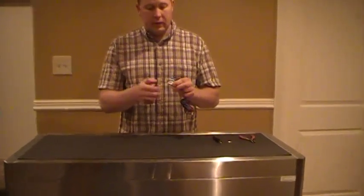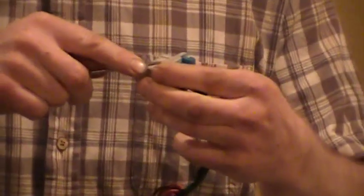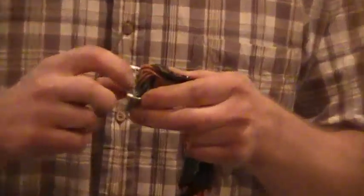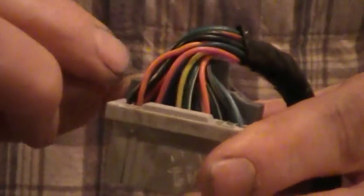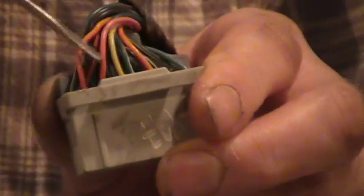I'm going to demonstrate how to get it apart. On this one, I need to remove the terminals from the top end. Take your little screwdriver and pop this little locking piece out. Mine's blue. On the 99 Silverado, Sierra, Yukon, Tahoe, and Escalade, you may run into the same colors. If you look on the back of this connector it says B1 and A, so you can identify which terminals you need to remove by wire color and terminal location.